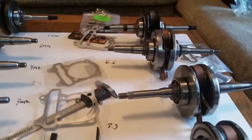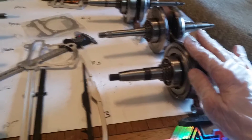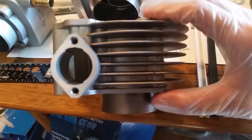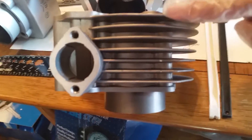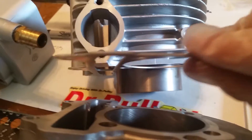To recap: 2.2mm and 2.5mm — you're good to go. For 3mm or 3.5mm, you only need to worry about the upstroke and can use a small spacer. These Tata 3mm and 3.5mm cranks are actually designed for Tata brand cylinders, which are a different height. A stock size cylinder is 68mm tall; this Tata cylinder is 69.3mm — it has the spacer height built in, providing the clearance between the cylinder and the motor block.